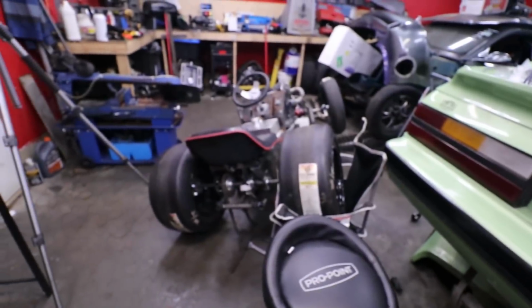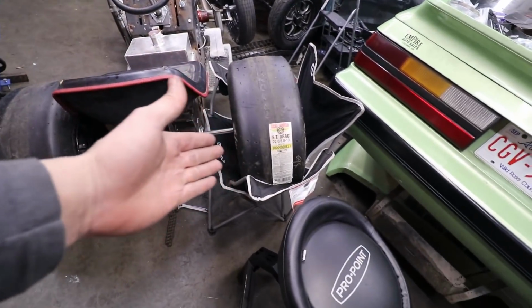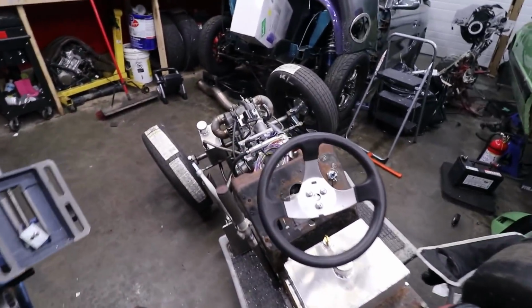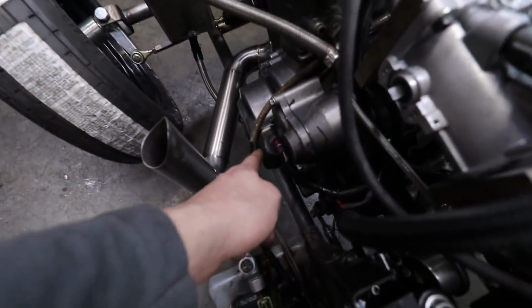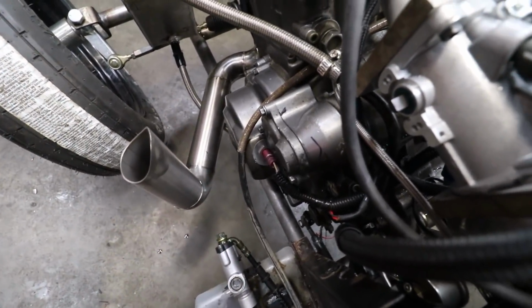Easy. Since I have to get underneath it to work, my best idea is to have it on its side. Just put it on a lawn chair on one side. Because if I tilt it too far, then the oil from the engine is actually gonna come out the crank sensor hole, and I don't want that. For right now, I don't want oil spilling everywhere.